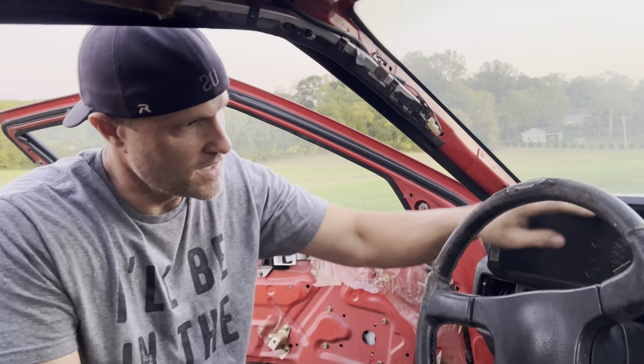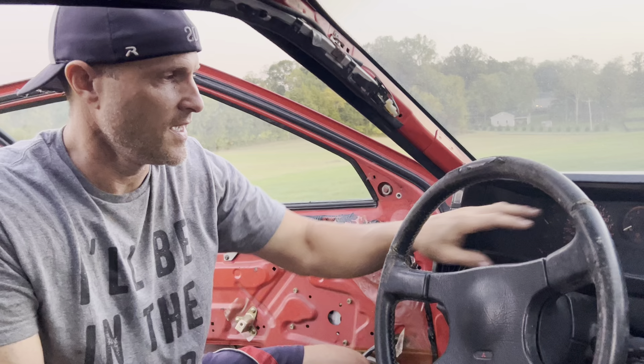This time I'm just going to show you a couple different things. The cluster hood up here — you have to remove this cluster hood, maybe yours is all cracked up. Sometimes the leather on these gets in really bad shape and you can just replace this top cluster cover. It's basically a few different pieces: a top cover, an inside casing, and these light switch assemblies for your headlights. This is one of the things I get asked for the most when the headlights don't work. These switches get all bound up, the springs fail in them, and they just stop working. So I'm going to show you how to replace all of this. Whether you have to replace just the top or the switches, it's kind of the same process — super simple.